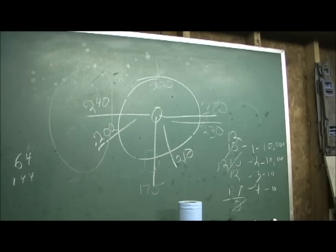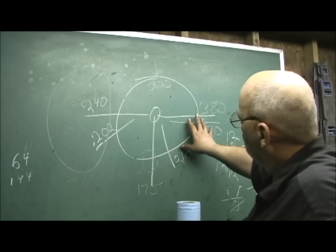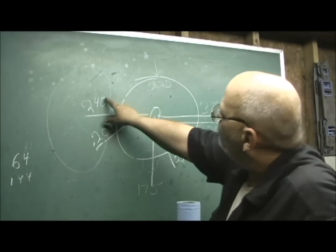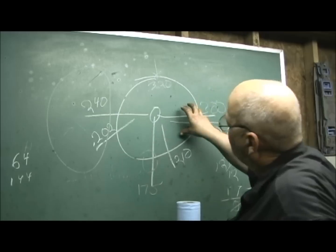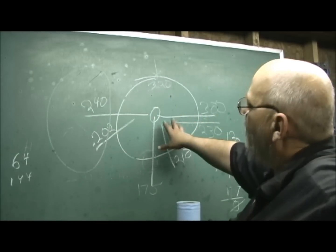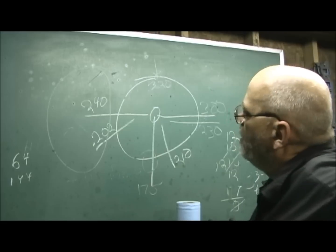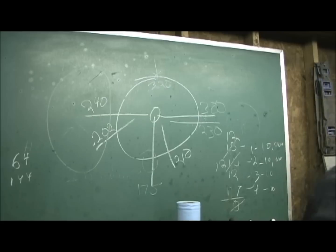Look what we ended up with. I went one step deeper — this was the first set of numbers, and every one of these numbers, as I went deeper, got between 30 to 40 thousandths thicker as I went in the bowl and the short turn. It's absolutely right there — no problem. When I got through porting it, I went back in on two sides and re-sonicked it, and I've got 120 and 105. So I don't think we're going to have any problems with any kind of cracking. Plenty of meat left. On to the valve job.